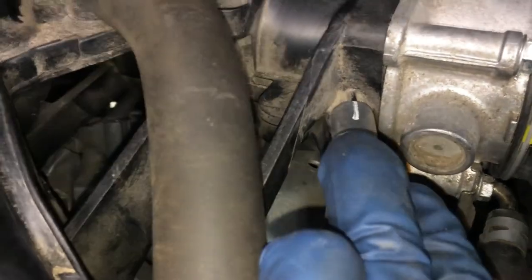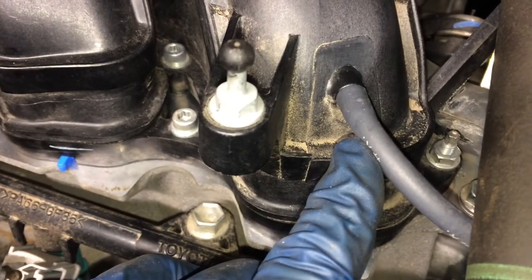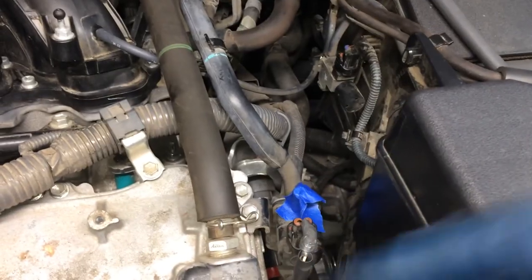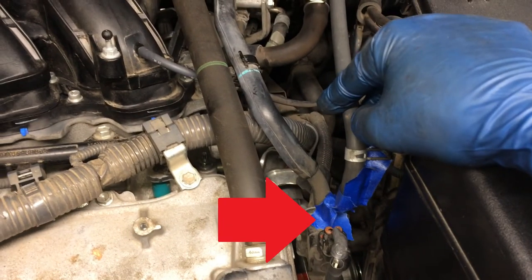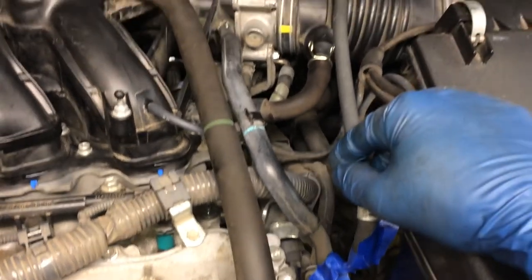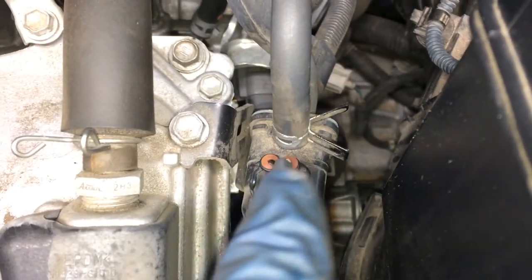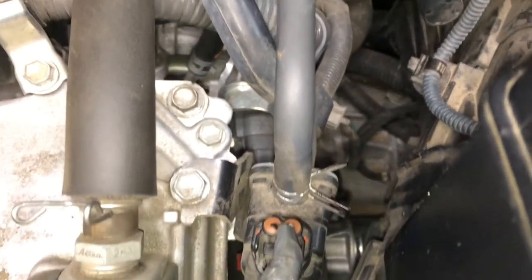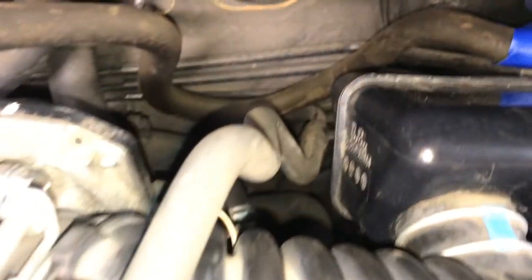Here's what I mean there with that one, with that white line, PCV hose up here, and this little vacuum hose here. If you disconnected this hose here that goes into this VSV, it's time to put it back in. That's the hose that goes right there. That's what I mean there. If you disconnected that hose, just push that clamp back down to where you can see it was. There's little marks that you'll see on the hose. This goes in here, and then that's running back there.